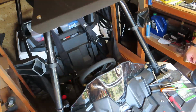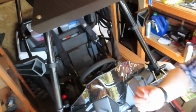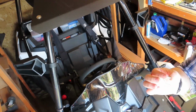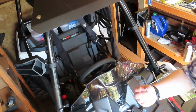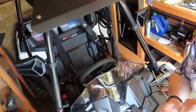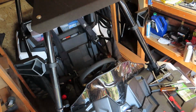Okay, we're making progress. These are the little inserts that go inside the battery terminal. It's got a little thread inside, and that's what your nut attaches to. Problem is, this is loose, floats around inside the terminal. I don't remember what I did when I put this charger on, how these didn't fall out, how I was able to reattach them. But what I've been doing, I got the positive attached now. And I've still got the two of these from the original battery. Well, there's enough room inside that terminal where you can stack them up. So then you can get your threads into the top portion. Don't thread it all the way in. Just get a couple going, and then you use a magnet and pull the other one out. So you don't have extra stuff.